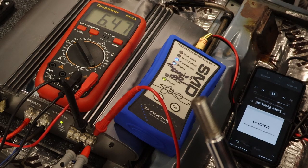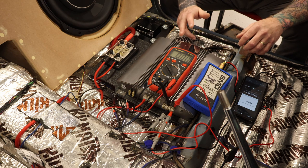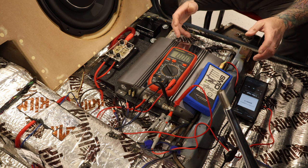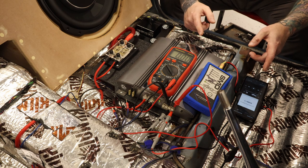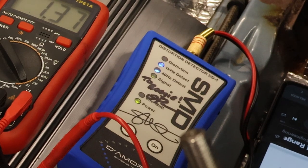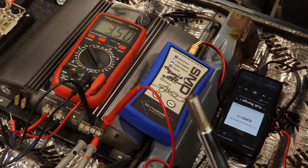Light went out at 49 on the head unit. Now, you may have seen the voltage didn't hit the number we were expecting — that doesn't matter for the head unit. Got a 1 kilohertz test tone queued up. I'll repeat the same process looking to find distortion on the DD-1. 1,000 hertz detect came on — now we're just looking for the distortion light. The distortion light never came on. That's a little odd — that's a perfect example of some of the frustration I've had with this whole setup. I followed the instructions to a T, did a lot more research, and found out basically there's a million variables. What I found is that the 1 kHz test tone would have a slightly higher distortion point than the 40 hertz test tone. So from here on out, I'm just going to run everything at a maximum volume of 48.